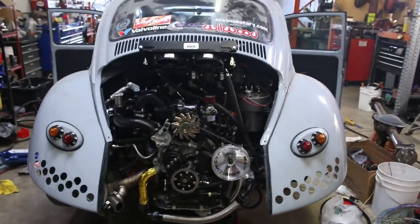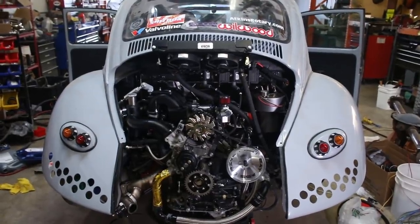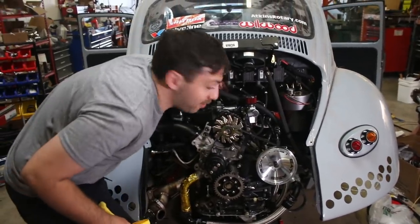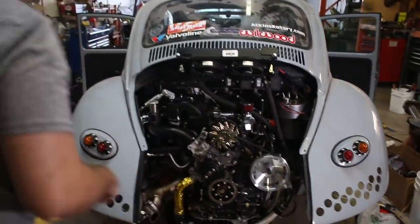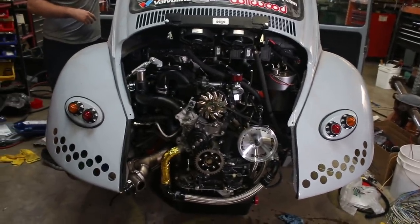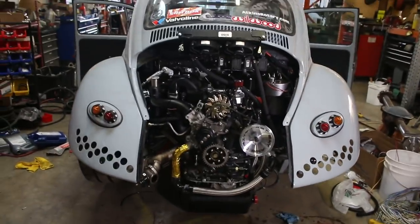It's difficult to give updates on James's car because there's an incredible amount of shit happening - an unfathomably large amount of shit happening in this engine bay. You can see how infinitely more complicated this engine is than ours. Just look at it - it's just plumbing everywhere. Here's a fun game to play: can you fit your hand through here to reach the firewall? No, you fucking can't - not anymore. What you guys need to know is that apart from timing, it's ready to go. So now it's just a test and tune, and you guys will be here for the first start. What James is doing is finding TDC of the motor - he's jamming a piece of wire into the spark plug hole at different crank positions. Mark top, mark bottom, the middle is TDC.